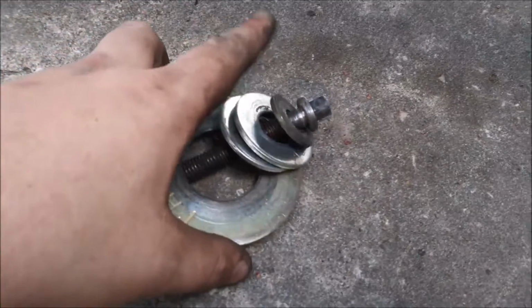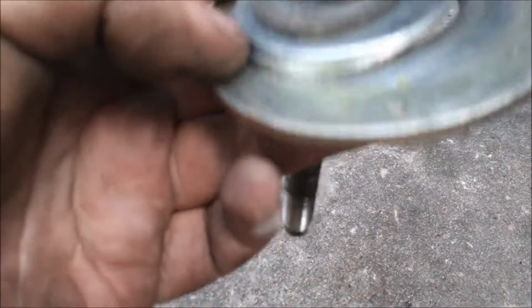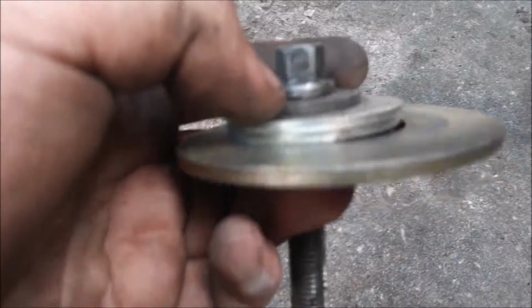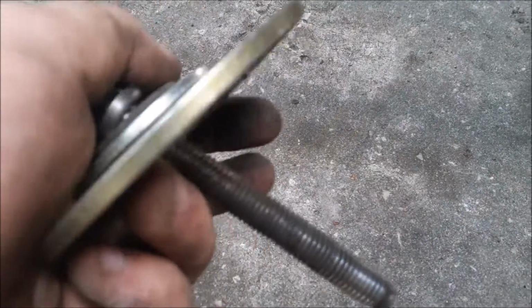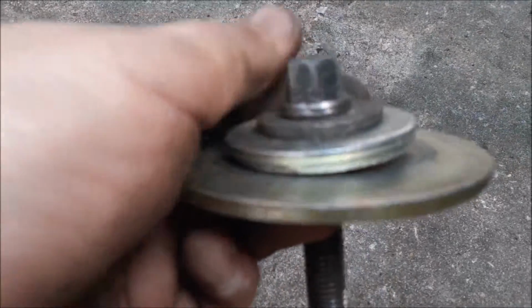Like that. There it goes. It's out. Alright, so it looks like this is the better kind of press that worked. I ended up swapping out the two washers on the inside for bigger ones. They're thicker, definitely. And then one more spacing one that I needed to keep the bolt from going through. This works pretty well, so if you're going to try to go through anything, do this.